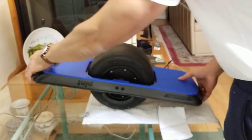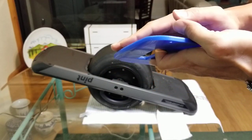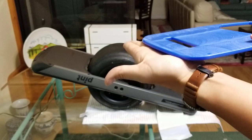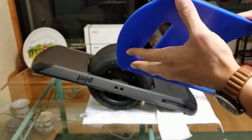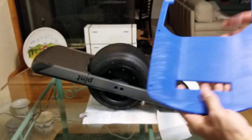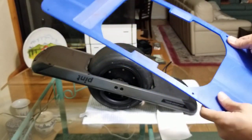The second reason I got this was the design. If you look at the terminal ends of this plate, it's kind of angled slightly up. So if this was to dig into the ground on a potential nosedive, you have that lip to kind of ride it out, or at least give you a few seconds to react and adjust your weight so you don't take a nosedive. This is also angled up on the other side as well.